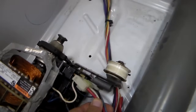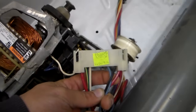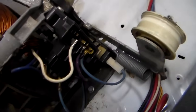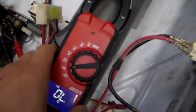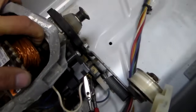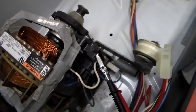The next thing we're going to check in the heater circuit is the motor switch. When the motor starts spinning, there's a contact inside that allows the voltage to pass from one red wire to the other, causing the heater to come on. If the motor doesn't spin, the heater is not going to come on, or if the switch is bad inside. Remove the plug, find the two terminals that connect to the red wires — they're on the outside — and connect your meter. I got my meter connected, set on ohms. You've got it connected to the red wires, your heater wires. Right down here there's a little black disc — go ahead and push that in. And the switch inside the motor is good. I do have another video on how to check that with the motor out, which I'll link in the description.